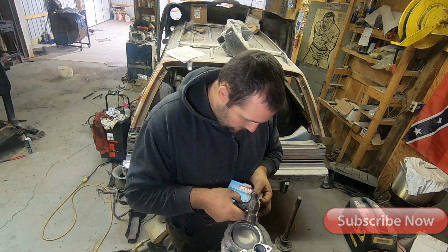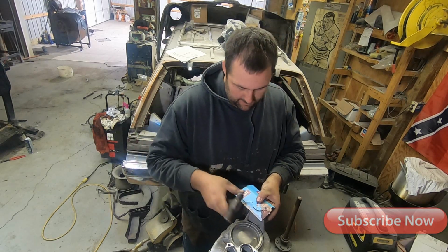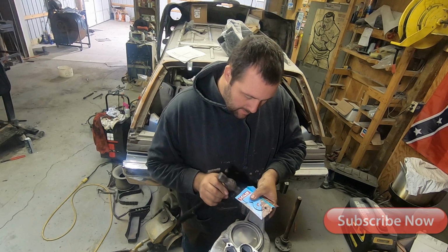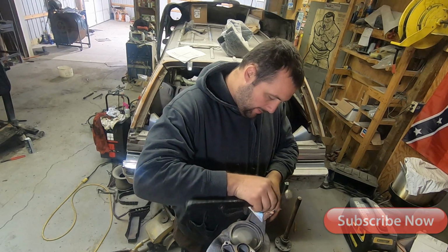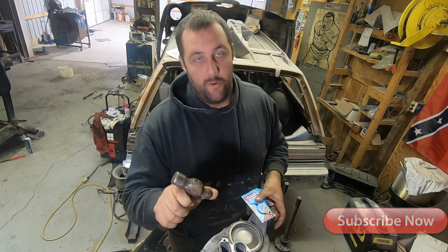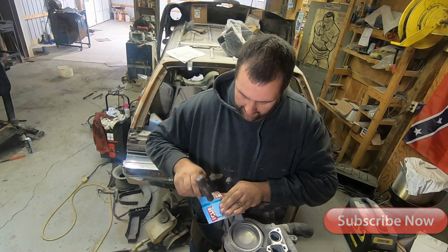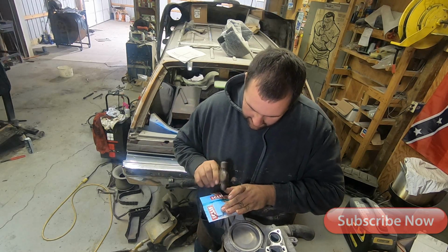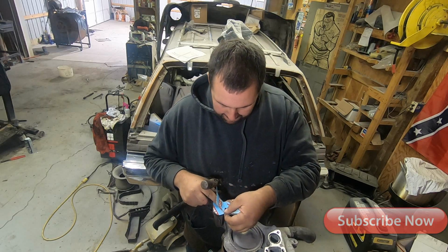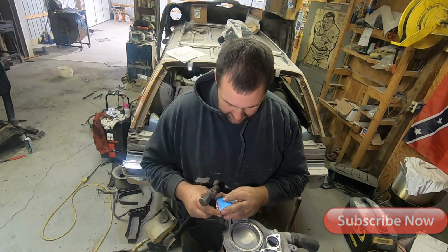You use the ball peen side of the hammer. And you just kind of tap your way around it, making sure to hold it down. And if you have a smaller ball peen, it'll actually work better, the smaller ball peen will get into these inside radiuses better. Let me finish this up. Okay, so that's our gasket for the most part. Now you can just go ahead.